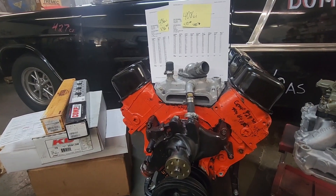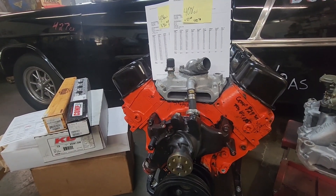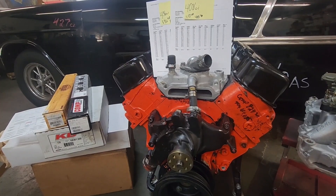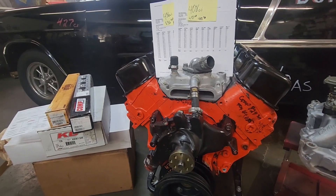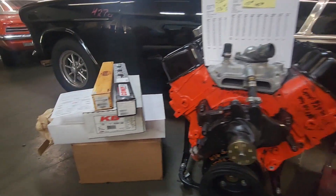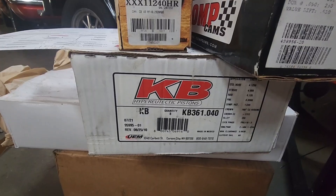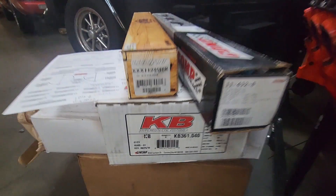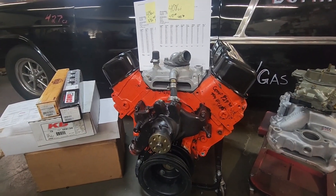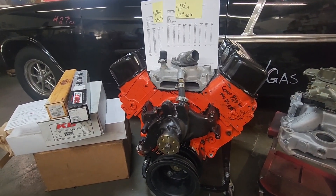It's been my experience the couple times I've done this: you just buy a 454 crank. You can reuse your 396 rods — the standard length rods work for a big block Chevy. The only pieces you need are the 454 crank, the correct harmonic balancer and flywheel, and the pistons. Keith Black makes a special piston that makes this project work — it's the KB361. These are dash-40s, but they make them in all different sizes. Not only did it take the cubic inches to 436, it increased the compression ratio to 10.8.